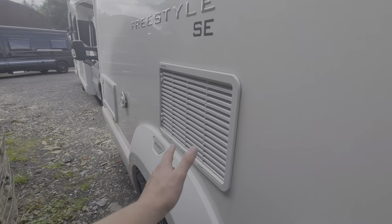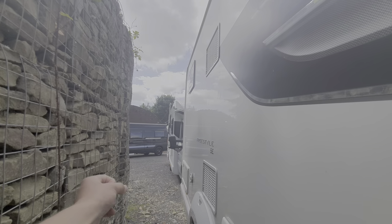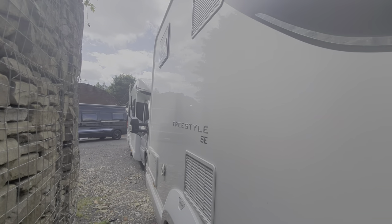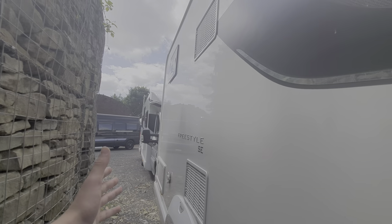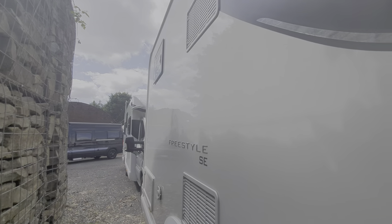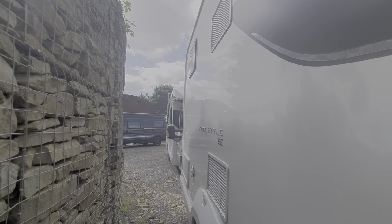Next to here, you've got each of your fridge vents. Your fridge vents — this is where air is pulled from, and it's what the fridge uses to cool the systems on board. If it is a hot day and you've got the sun beating down on this side of the vehicle, obviously it isn't going to work as efficiently. With that in mind, try and keep this under shelter or shade just to help that along.